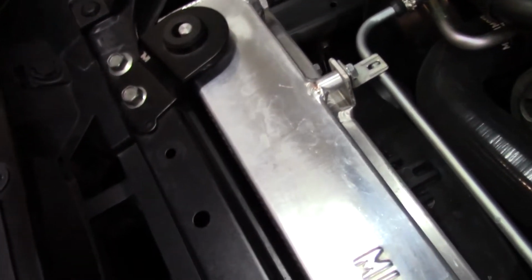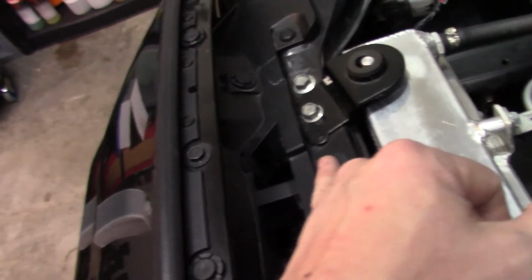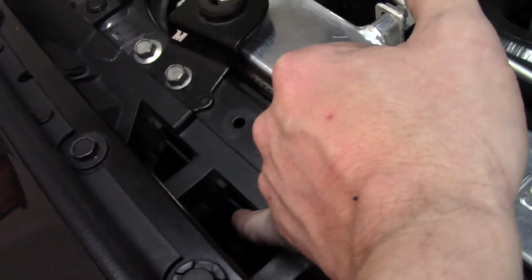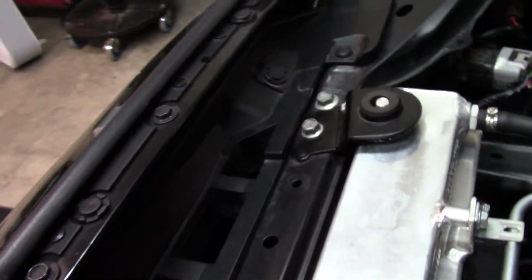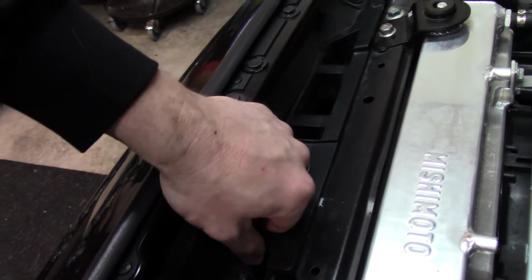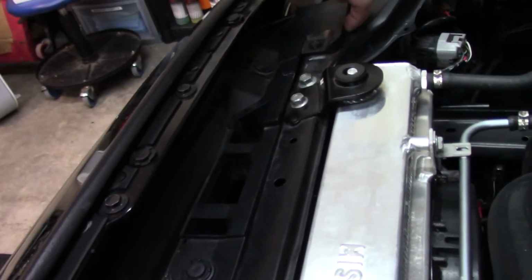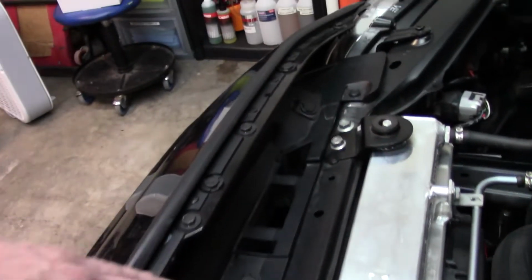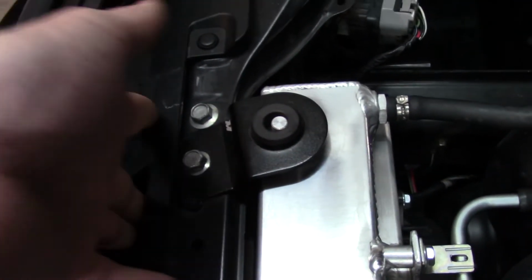Now what I think I'm going to be doing, instead of removing the front bumper, because that's not going to give me access, because this chassis support right here does have, not necessarily a wall, but a piece of angle that goes down this way. What's in the way currently is this plastic shroud that covers up the mechanism for the latch and kind of just molds into the front bumper. This is one separate piece, so we're going to pop off the pop clips on here and see if we can take this plastic piece out to get my fingers underneath to hold this little screw.